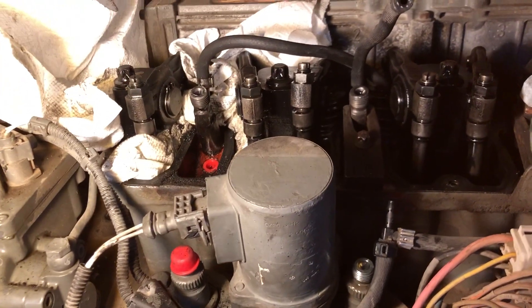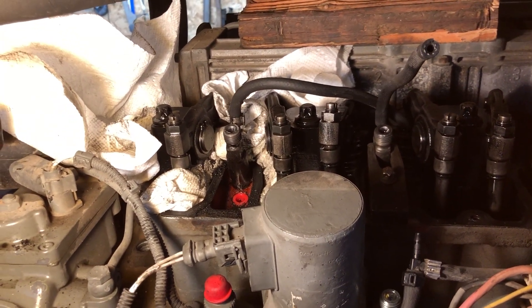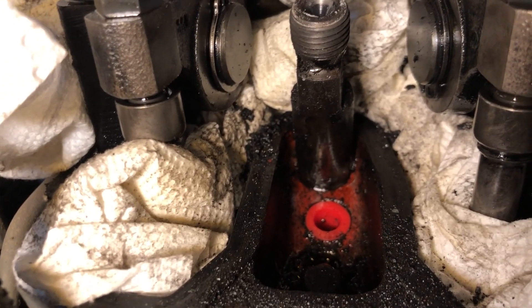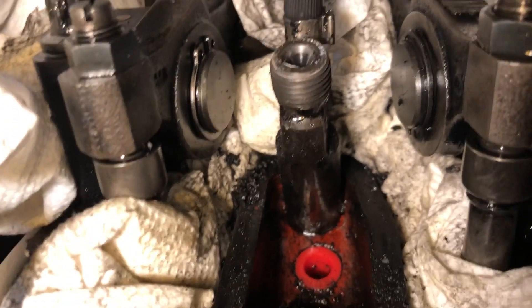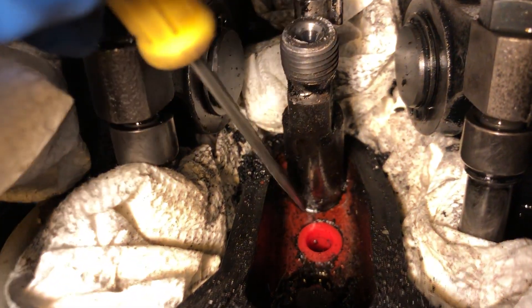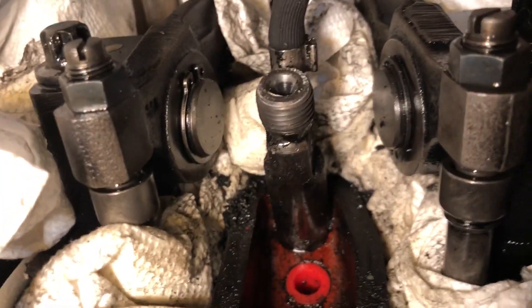This is a little video to show how easy diesel injectors should be to come out. I have an injector here that is stuck in the head — that little red plug down there covers the glow plug hole. There was combustion byproduct built up all around here that leaked past the injector, built up like an anthill, so that injector is stuck in the head.